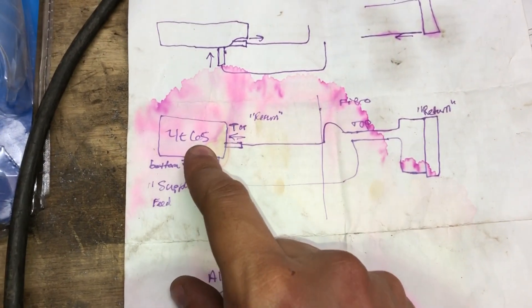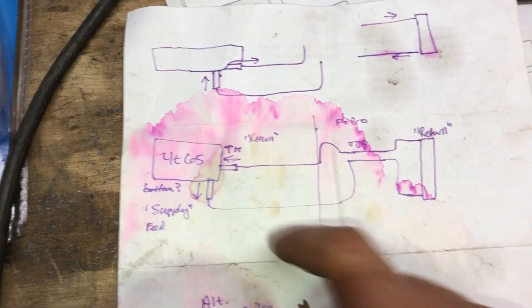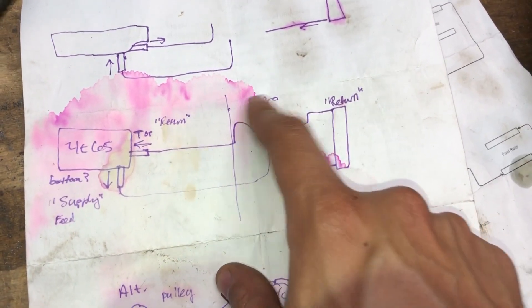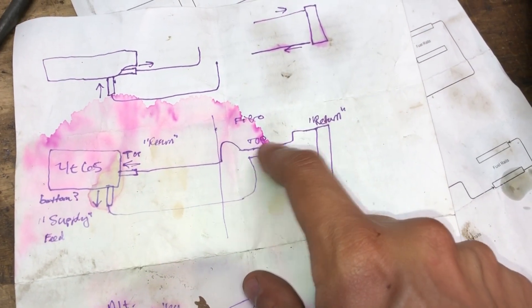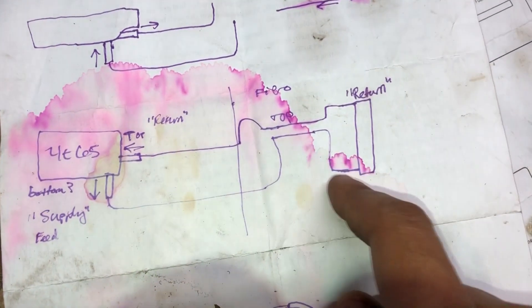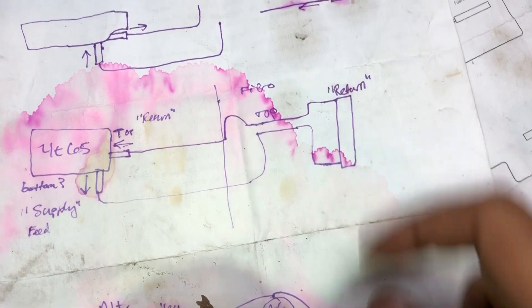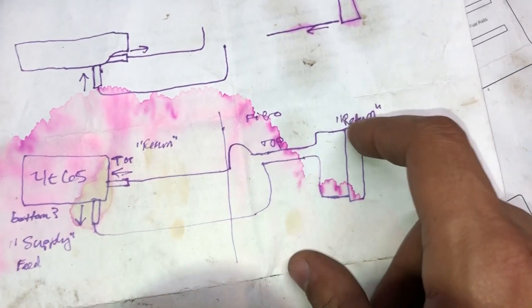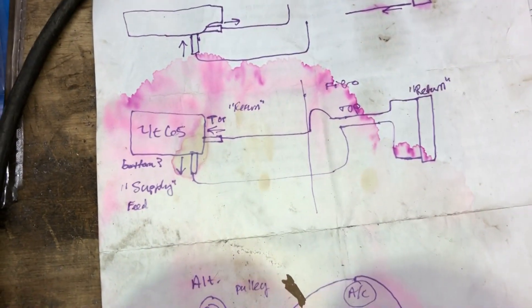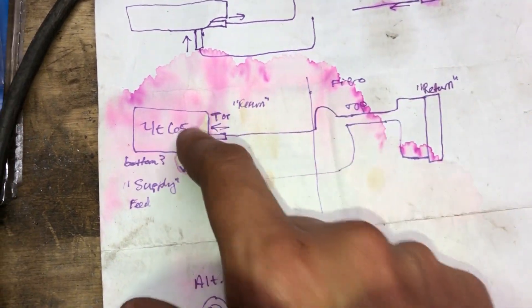For the transmission lines, you have a fitting coming out straight at the bottom of the 4T65 transmission. The Hero has two hookups — imagine these being the hoses parallel to the ground. One is parallel to the ground and one is looped and comes out facing down. It flows through the bottom one into the bottom of the radiator, up through the top. Forcing the tranny fluid in through the bottom and out the top is more efficient for cooling. Bottom goes to bottom and top goes to top — makes sense.